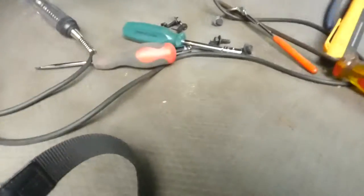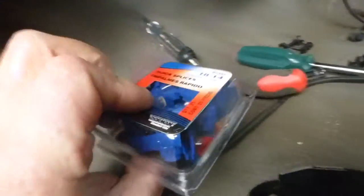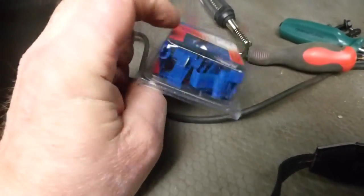I've been wrestling with getting access to the stoplight switch, which is really hard to get to. It's way up there, but I traced the wire down and now I can get to it. I've got to use the little crush connectors, which I hate, but it's the best thing to use in this case.